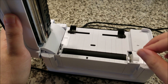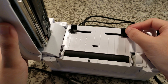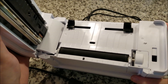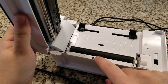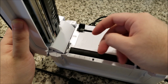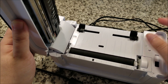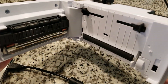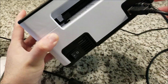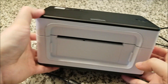On the bottom it's pretty simple — there's a roller with a visible gear that spins to advance the paper, and small tabs that move in and out to accommodate different paper widths. There also appears to be an IR sensor on the front: when you first insert a label, it'll push it out and pull it back in to align it so it knows exactly where the label is. On the back we have the power switch, power input, and USB.